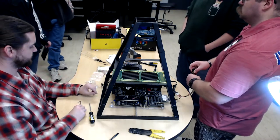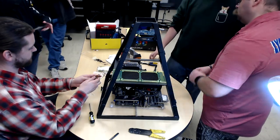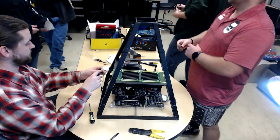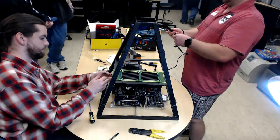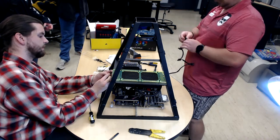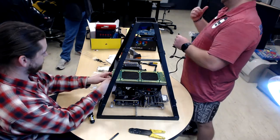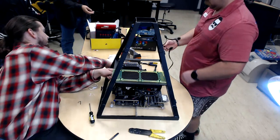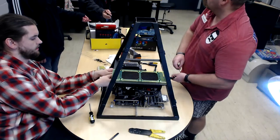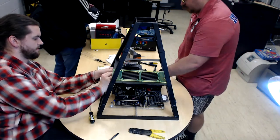I know I have one. I can check. I do have a fan splitter. I need to go ask Troy and Scott and see if they have one. Yeah. Molex. Because the way this connection works, it's a tail. And the way SATA is, it's always at a 90-degree angle. So we don't have enough space to go 90-degree into here. If you get that converter from Molex to SATA, it'll be just a straight shot in. So, one of those hot boys. Yeah, that's what I'm saying, the way this is right here. It just won't work. Even if you bend it as much as you can, I'm putting a shitty amount of strain on there, and I don't want that.